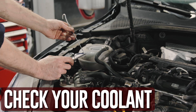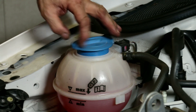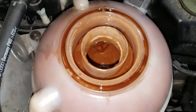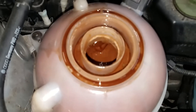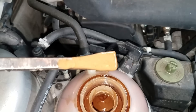Check your coolant. Since your coolant system is sealed, whatever you put in it ought to stay there. Although variations in temperature and pressure can cause the levels to vary slightly, they should largely remain constant. Therefore, if you find that you need to keep adding coolant to the system even though there isn't a visible leak, there's a good chance that coolant is going somewhere it shouldn't be inside your engine — entering the combustion chamber as smoke, or the oil channels as milky-hued oil.